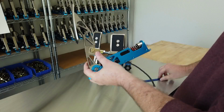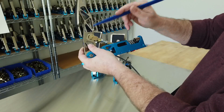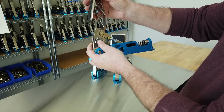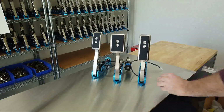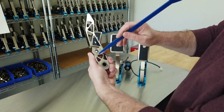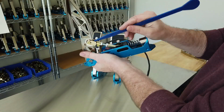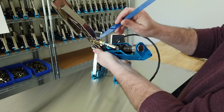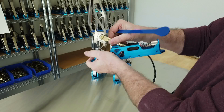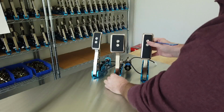We even have O-rings in the pockets of the pedal arms, in between the pedal arm and the clevis. I call these the TB O-rings. I'll show you. So on the pedal arm, you see this groove. That's where the O-ring goes. So the O-ring is sitting in there, and so once again, with a deviance in clearance here, instead of rattling and making noise, it's nice and tight because of the O-rings.